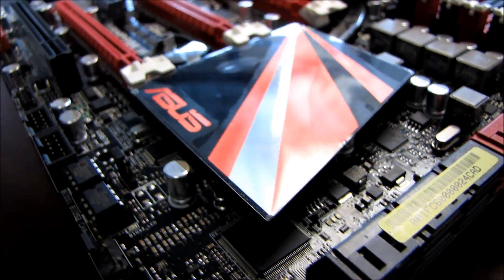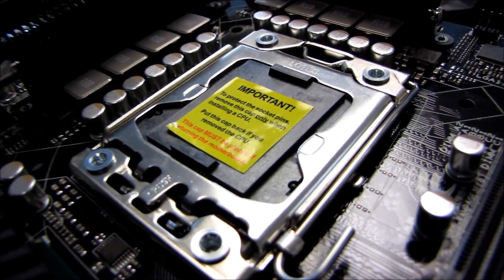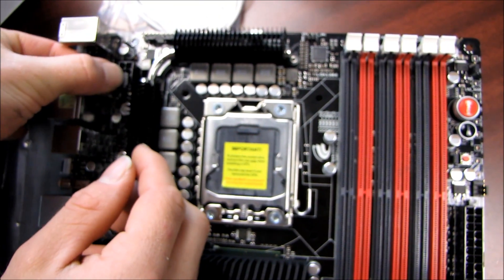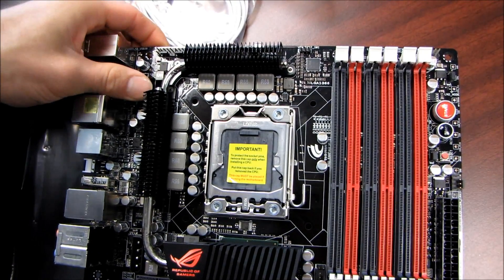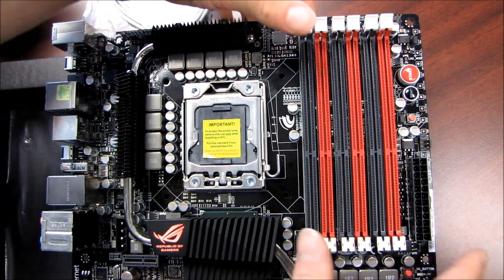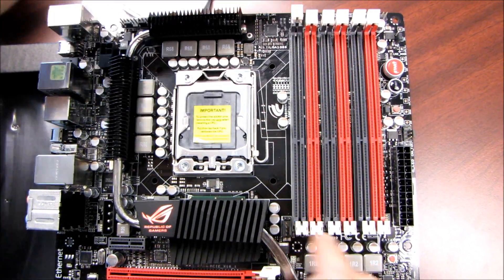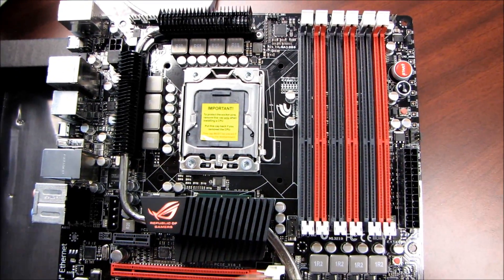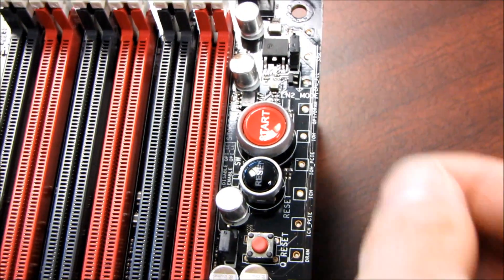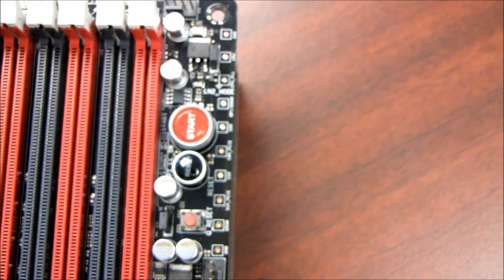Let's look at the overall board layout, starting with the CPU socket — that is an LGA 1366 socket with support for Core i7 and Core i7 Extreme. You've got your 8-pin power connector with the optional 4-pin cover placed on it by default in the top left corner. You've got six RAM slots supporting dual sets of triple channel DDR3 memory with the quick-install DIMM slot — clips are only on one side, so you insert the module and clip it down on one side. Your 24-pin connector is in its ideal location along the right-hand edge, and you've also got start, reset, and all your voltage measurement options conveniently along the top right-hand side of the board.